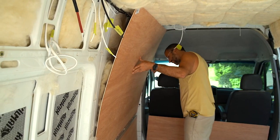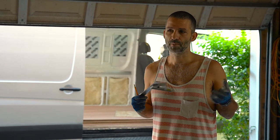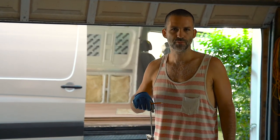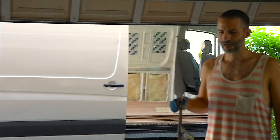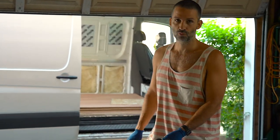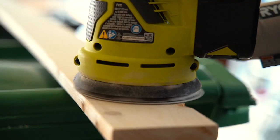Last you saw us, we had decided to use wall paneling for the whole wall and ceiling. But after watching more YouTube videos, we were concerned that wall paneling wouldn't be strong enough on top of the ceiling, so we wanted something sturdier. We really wanted to do wood — we found cheap wood and did more research online. We realized that the wood sold at Home Depot, Lowe's, and Rona listed as one-by-four wood is actually 0.75 inches thick (three-quarters) and three and a half inches wide. So the wood is actually thin enough for what we want. Yesterday we measured the different lengths, today we're going to cut them up, sand them down, and hopefully get to stain them tonight.